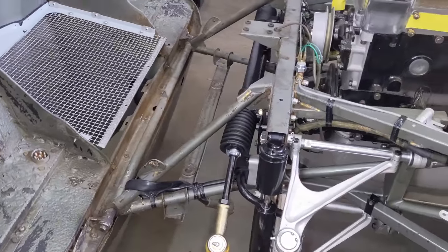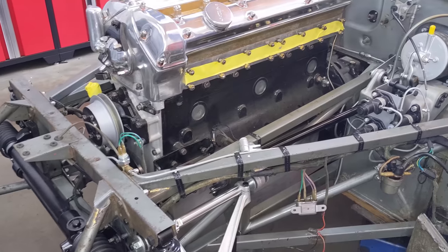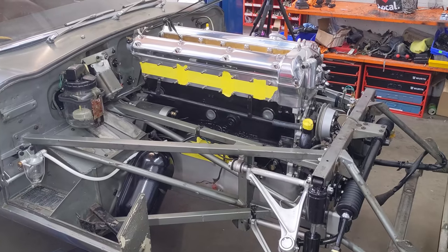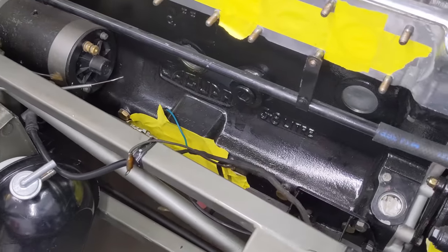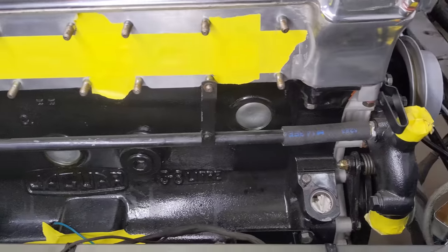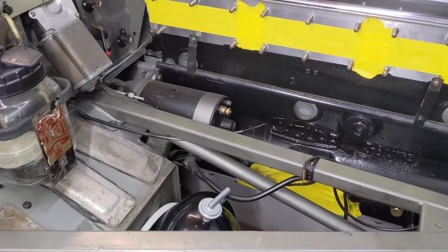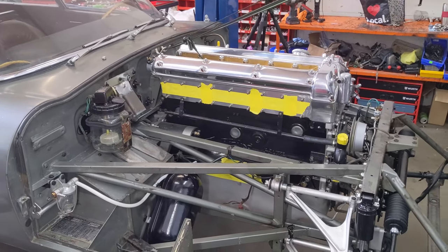Right here's where the cooling system will be — we have an amazing radiator. I can't wait to show everybody the install on this side. And of course, the exhaust is missing, so we're going to put on the original exhaust manifolds. The brake reservoirs also will go in this area. On the passenger side, the triple carbs are missing — we'll put those on. Got to put the oil filter housing on the engine as well. There's a coolant line that runs from the water pump underneath the carburetors to the firewall tubes, taking coolant to and from the heater mechanism and the heater control valve. I've got to get that set up before the carbs go on. I've also got to put the air filter housing and intake plenum on. Lots to do in this engine bay — let's get started.